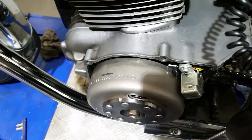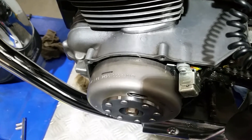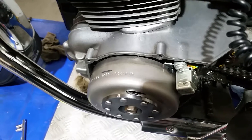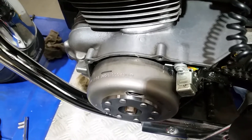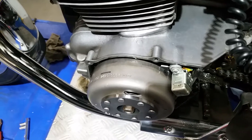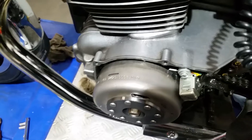As is the generator. On the 250, it should reach those marks between 5,450 RPM and 6,300 RPM, which seems quite high, but those are the Honda figures. I'll try and fire the bike up now, hold the timing light and the camera, rev the bike, and we'll see whether we reach those marks.